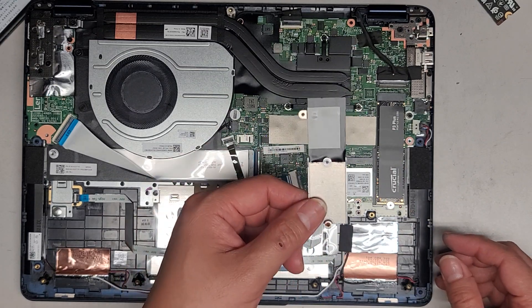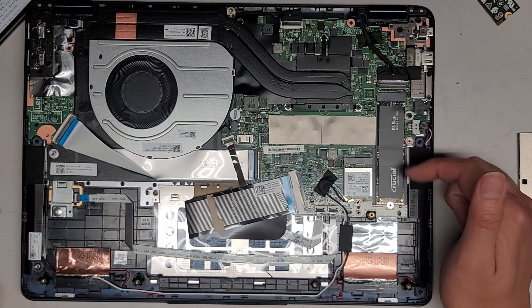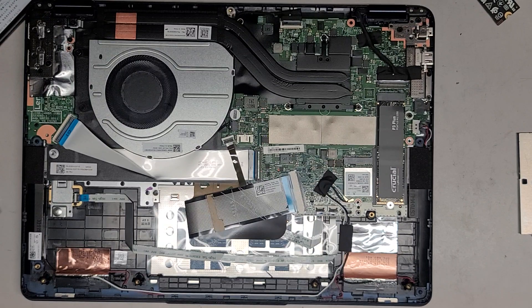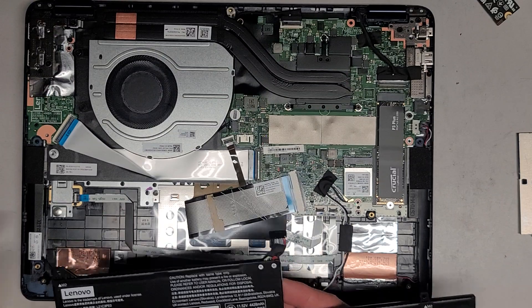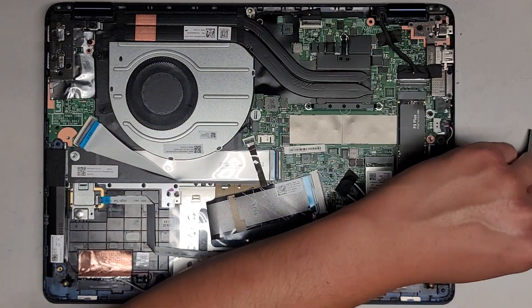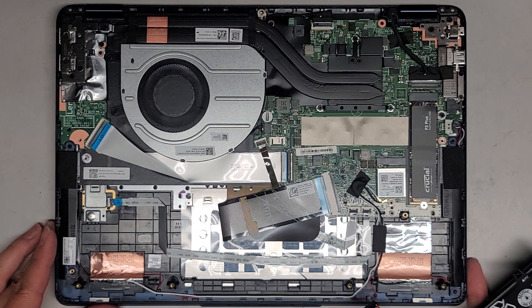This tray is pretty much garbage now because usually if you're going to put in an SSD, you're going to use one of these full-sized ones. Let's go ahead and put this thing back together and we should be good to go. Hopefully the clone worked out well. I did have to disable BitLocker first — the device encryption — and I also had to turn off secure boot to let me boot my bootable software to clone. Though there are ways to do cloning without having to boot.